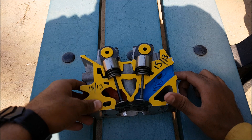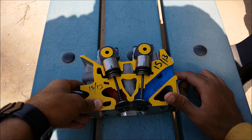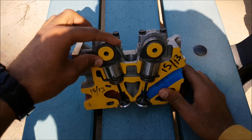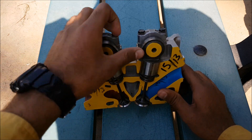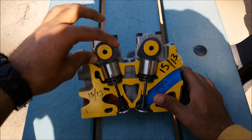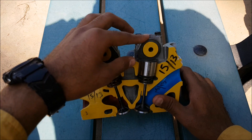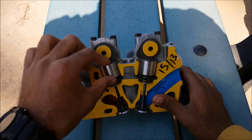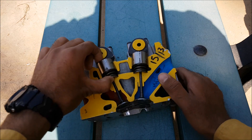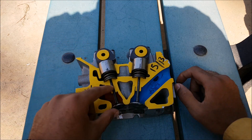Here is a model of the dual overhead camshaft — DOHC. In this model you can see there are two overhead cams: one is here and the second one is here. The parts include the camshafts, the bucket tappet, retainer springs, and the exhaust valve.